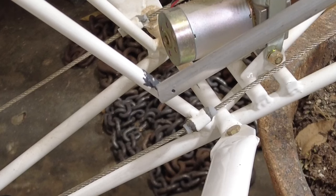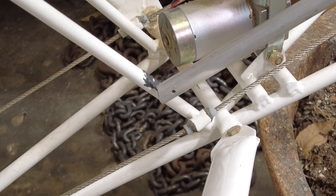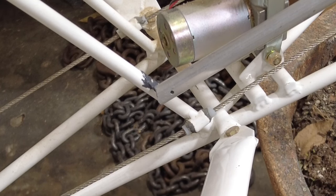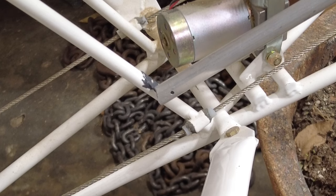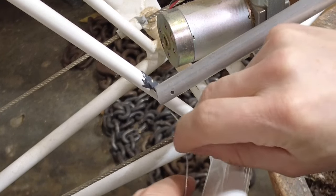Eight rivets done. For this back piece I'm supposed to use some 0.032 wire through the back end — I've already got the micro balloons mixed into the epoxy. I went to box two first, which was fruitless, then to trusty box five and found 0.032 safety wire. I've got my cheater pliers — any A&P will probably tell me not to use those, but I've got my 0.032 safety wire and my cheater pliers from Amazon, listed in my tools list below. I'm going to run a little bit of this through the hole and out the other side.